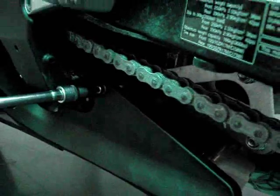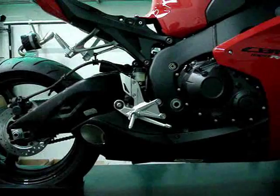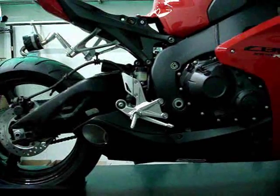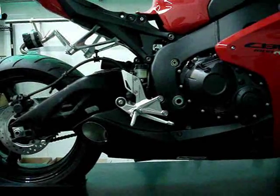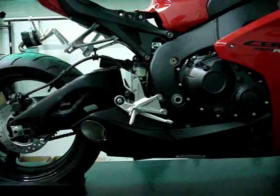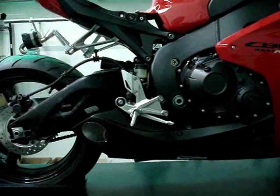That is the fitting of your new tailor-made exhaust. Now the last thing to do is to fire it up, check that everything is running well. Take it for a good ride, and then after 100 miles or so, be sure to go back and re-tighten the inlet clamp onto the headers. Very important — make sure everything is tight. Ride safe.